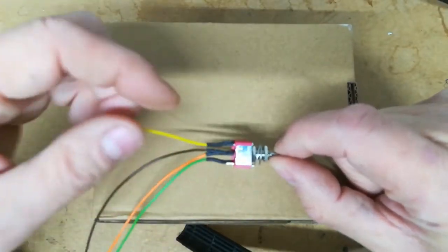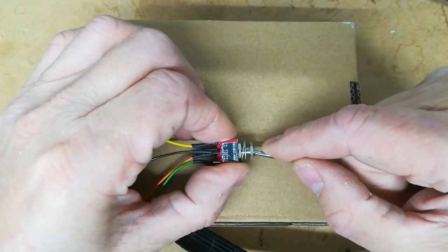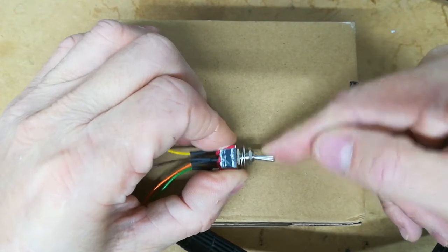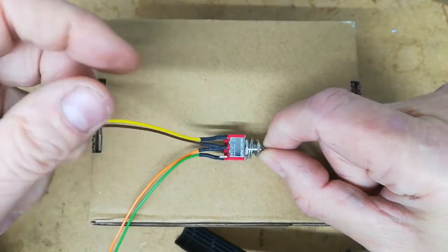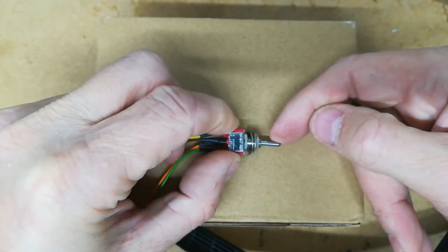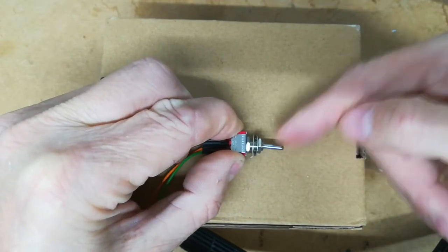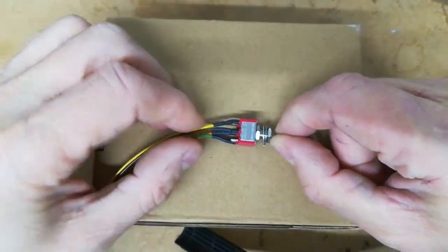So all this is going to do, we put this in parallel with the brake switch, which is already in the CRZ. Then when you pull this down, momentary action, while you're holding this down, the car will regenerate at a higher level if it's actually regenerating at all when you press it. So you don't have to press the physical brake. You gain a little bit more efficiency, and if you're a good hypermiler or a good economical driver, then when you're coming up to junctions and things, you can use your electric brake, which gives you slightly more braking, in preference to the foot brake, and you'll gain a tiny bit more efficiency and keep your battery at a slightly higher state of charge.